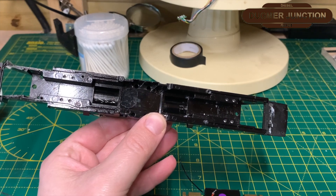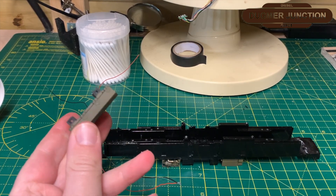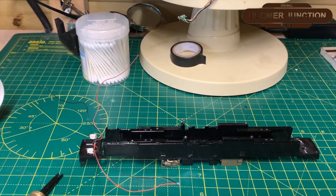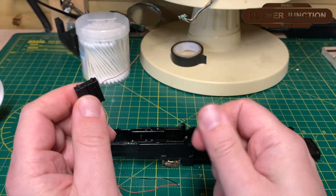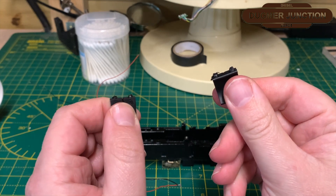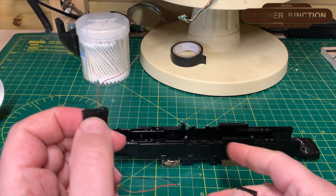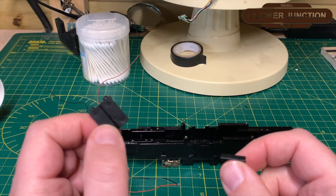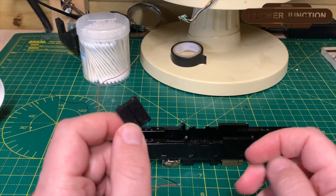So that's the fuel tank taken away from the bottom. It is literally just held on by four little clips, but you just have to be careful because when you bend these little clips they can be a bugger to get back and fit up against the chassis again. Now when the four little locating holes go the rubber grommets with these two little nipples on the end. You may have to modify the little nipples — cut a little bit of them away and reshape. Because I think when they get put in at the factory they might blob the ends to stop them falling back out, so when you force them out and try to put them back in, the width of the nipple can be too big to get back through the holes.